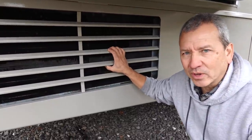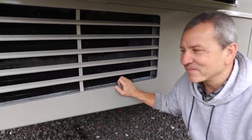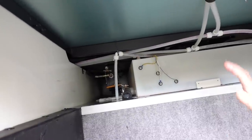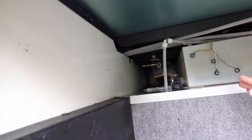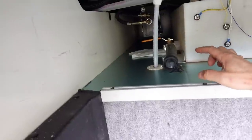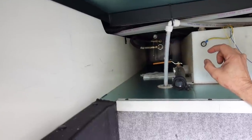So far this heat pump has been working really really well — it heats well and cools well, and I hope it stays that way. One thing I haven't done yet is replace the springs on the hydraulic jacks. I've tested them and they work fine, but the springs need to be replaced — I just ordered some and I'm waiting for them to show up. I also noticed some hydraulic fluid pooling up underneath near the hydraulic component for the main slide-out, but it was a simple fix to just tighten down some of those fittings, which seemed to stop the leak.